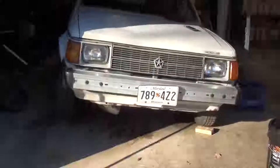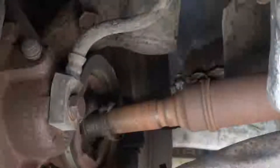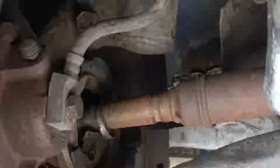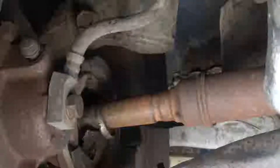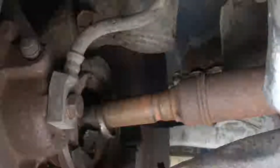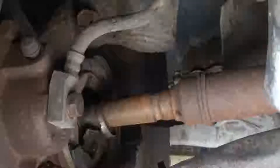The first thing to do was to get the car up on some jack stands to see what's going on with the axles. As you can see here, that axle is just shot — it's just spinning away like a madman in there. Problem confirmed. It's a little curious that it's turning even though it's in neutral. The only thing I can think of is there's just a little bit of pressure on the clutch maybe, or it's just out of adjustment. I hope I didn't do anything internally to it, or maybe it has something to do with the fact that both wheels are off the ground.